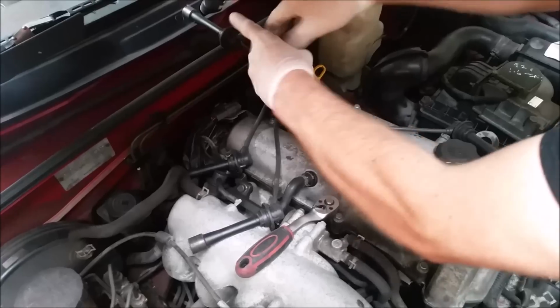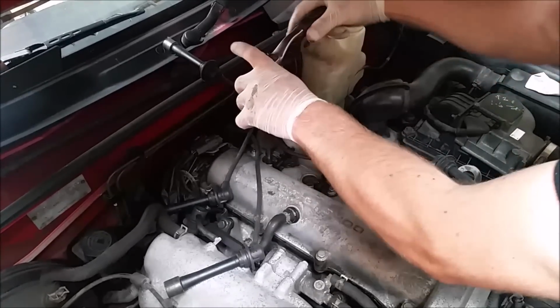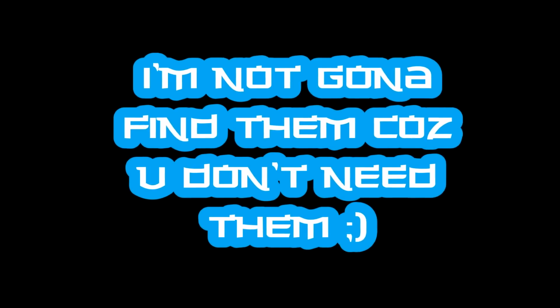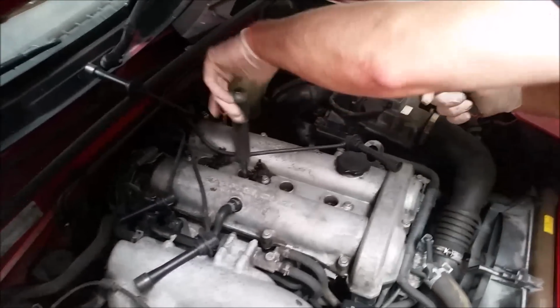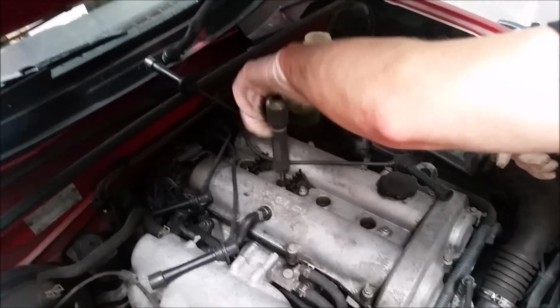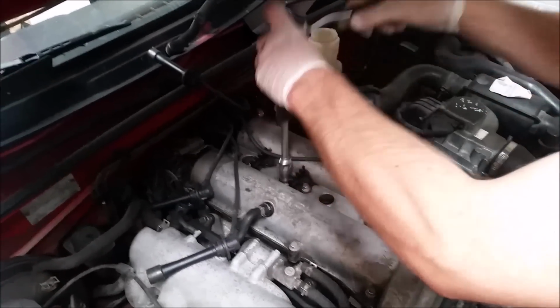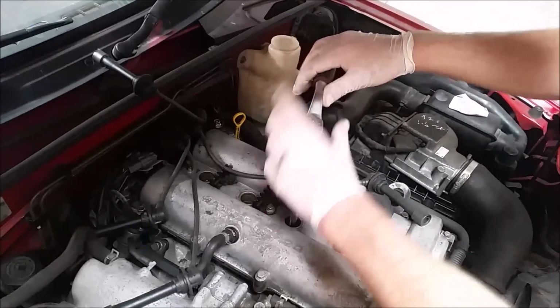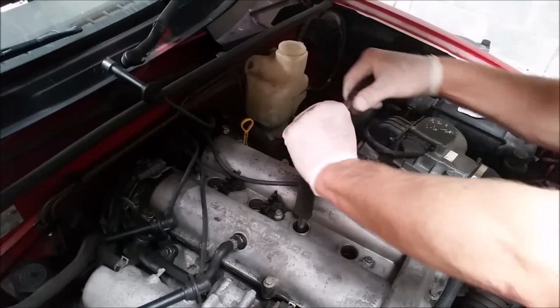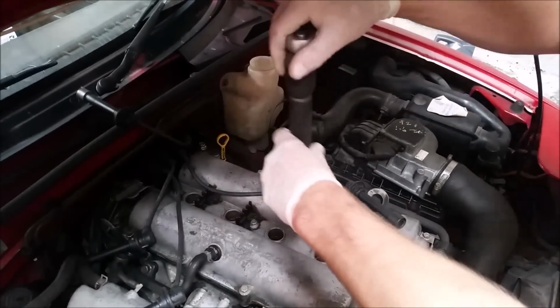After that, just tighten the spark plugs. Not too hard, you just have to feel it. I'll try to find the Newton meters. We'll try to find the torque figures for the end of the video. Obviously no one has a torque wrench, so do it by feel. Not too hard, not too tight. The one thing is, I've never seen a mechanic tighten spark plugs with a torque wrench. Everybody feels it in their hand when it stops. Actually, after you break three spark plugs, you'll be fine.